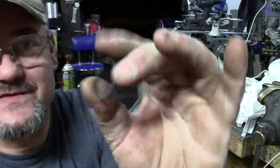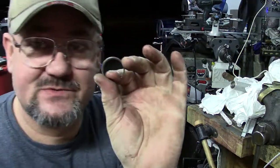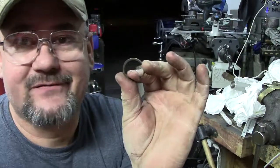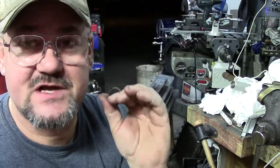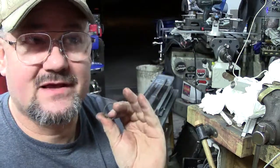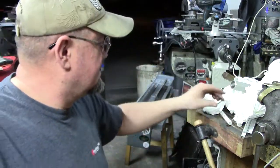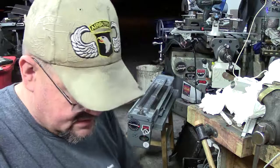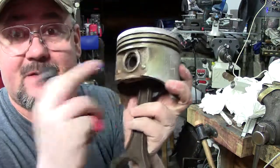They're not expensive. I actually found new old stock ones, which you can still get from Ford for like 15 bucks for 16 of them. So that cost me a block. It was a real nice 410 Mercury block that was bored like, I want to say 60 or 90 over, I don't remember. Anyway, it's one of them things, you replace it. It's kind of like changing oil and filter. Even if you're going to put these back in an FE motor, change those out.